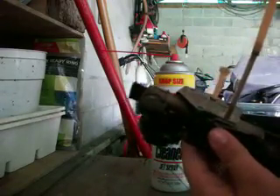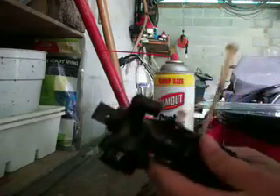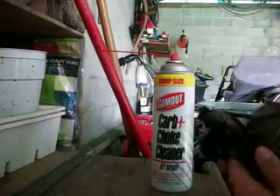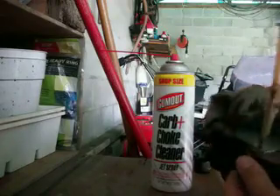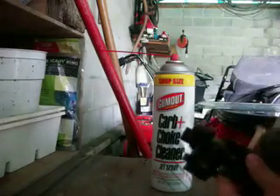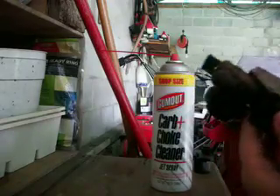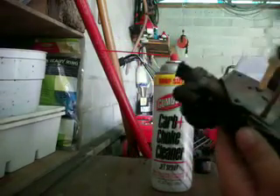After we do this, you're going to want to spray some carb cleaner inside these screens. I'm going to wipe away this carb cleaner that just cleaned the top of this. The other thing we're going to do after this is check the jet and the needle on the carb.